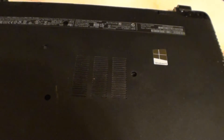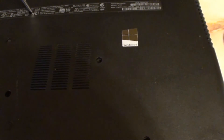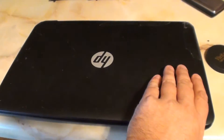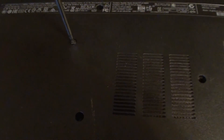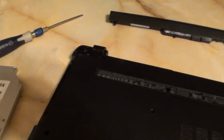You got your keyboard back in, you're happy with it. Let me put the screws back in so I don't lose them. Now if you want to do your DVD drive, your DVD ROM — if you're looking at the top of the laptop, you just take out this particular screw here. You'll have to take this out to crack the whole case anyway. Just take that one screw out, get something in here, and she just slides out like that. Easy peasy.